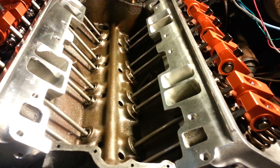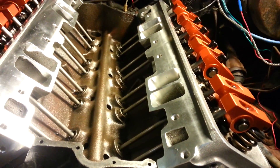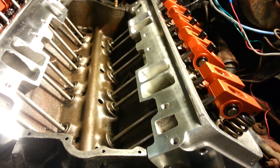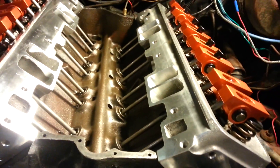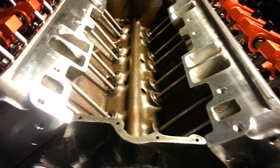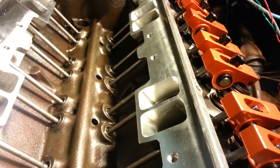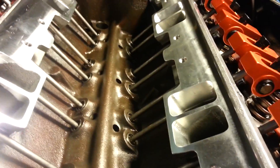We're looking at this one in particular where we've already got the intake up. As I turn the engine over, you can see the intake starting to come down now. So now the intake and the exhaust on the number three cylinder are almost fully closed — it's come down all the way. Now you can see on number three they're both closed. So now you're going to keep turning it over until the intake is closed all the way and the exhaust starts to open.